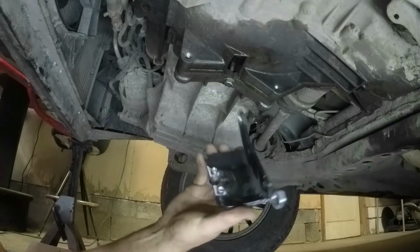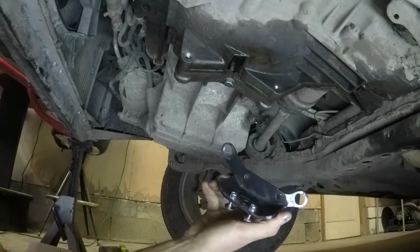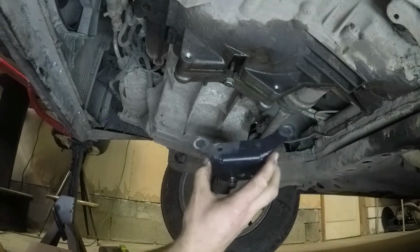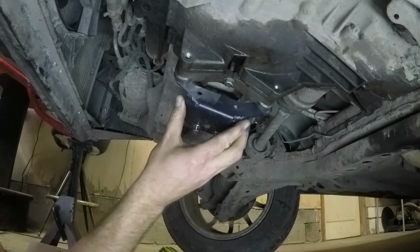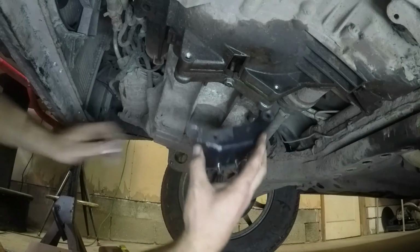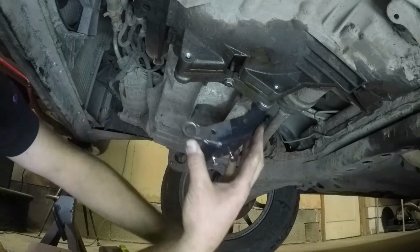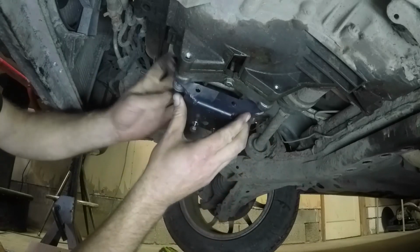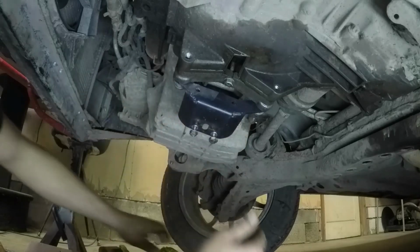Okay guys, here's what I figured out. This bracket I had laying around, it was a part from the old exhaust system on my Harley. I modified it so it lines up with these two holes here. More rivnuts, and then the skid plate will bolt right to that. This will just live right here with the transmission, so if I ever have to take the skid plate off, I don't have to worry about trying to take these bolts out or anything. It just bolts right to this.